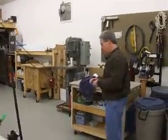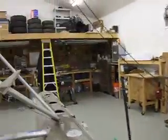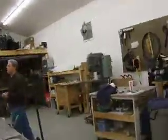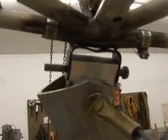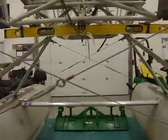Since these floats came off a Cessna 180, they didn't expect them to be a perfect fit. But as it turned out, only the rear struts needed to be shortened — cut down with a bandsaw. Pre-made welded fittings and the 2024-T3 blocks were then put on temporarily. The rear fittings aren't completely welded yet; that will happen after the floats are removed and the fuselage goes back in the rotisserie, which rotates 360 degrees for the best welding angle. They were tack-welded and temporarily secured with hose clamps. The flying wires used are not final — they're shorter than the Cessna 180 ones by several inches — but were used for mock-up and rigging.